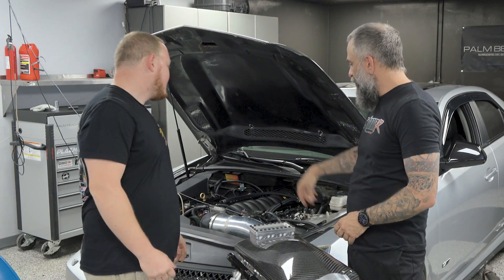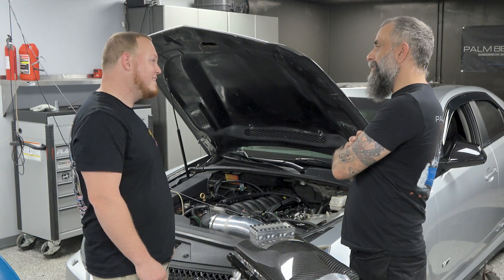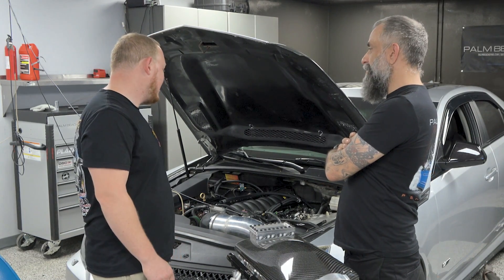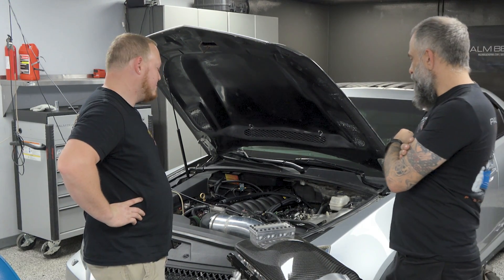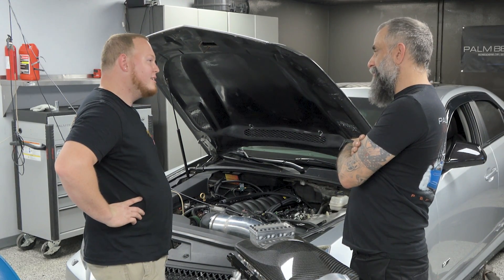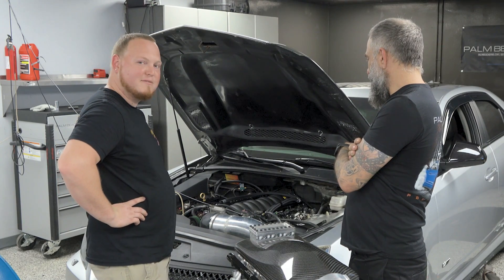I don't know anything about these, so I guess start with the engine configuration. It's a 5.3 truck engine that I had sleeved with Dart sleeves. It's got a 423 setup in it right now. It's got a custom spec cam from Martin Smallwood, and the heads are just Trick Flow 255s off the box. It's a bottom-mount twin turbo kit that I pretty much just threw together myself — just cheap China Pulsar turbos, nothing fancy, nothing crazy.